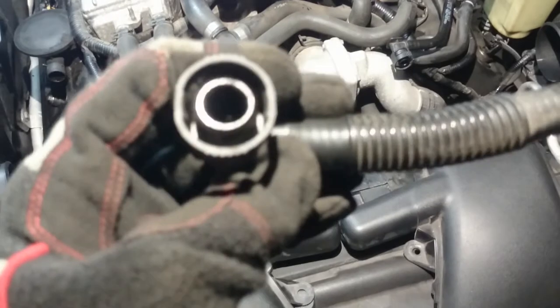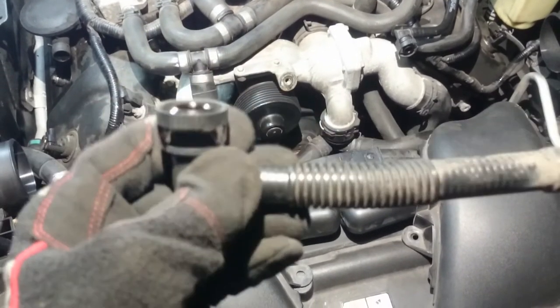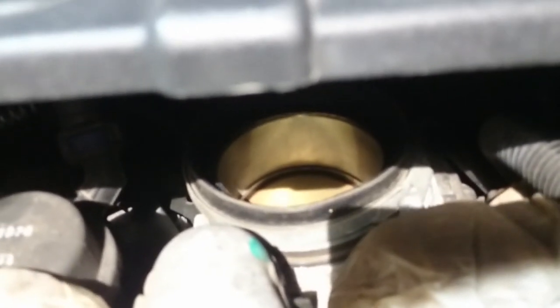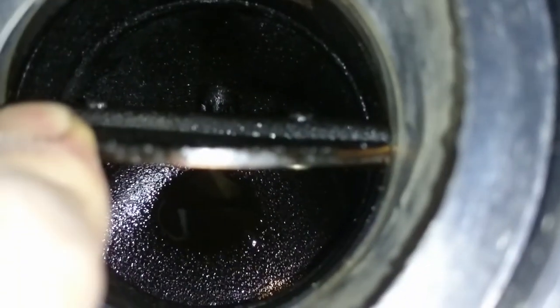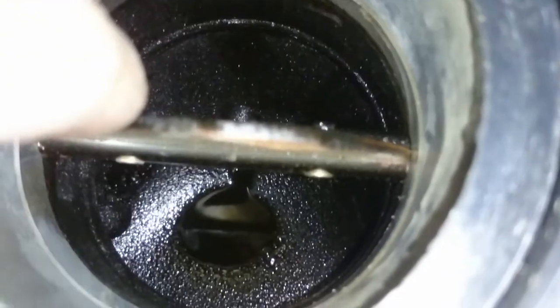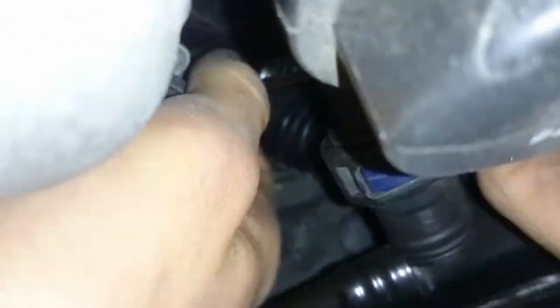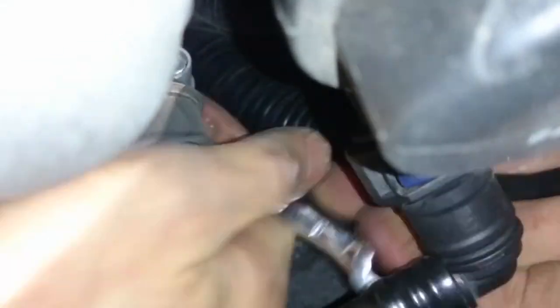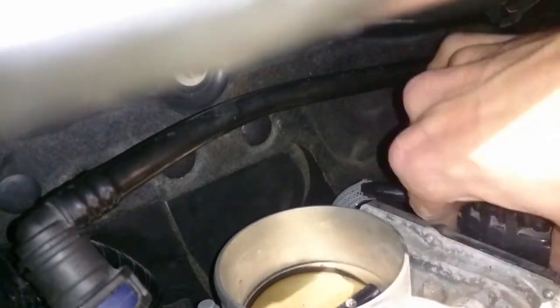I also broke an EGR bolt — a very plastic pipe that was ready to break at any moment. I went ahead and was able to pull off the top intake for the supercharger and to the back of the throttle body, as you can see right there. The top looks shiny, but there's more than meets the eye here. Check that out — that's all oil deposits, junk, gunk, and carbon. Super gooey and just nasty — this is ridiculous. So I went ahead and started diving into actually taking the throttle body completely off, getting it movable and loose. This took a long time because I could not see back there at all, just using a small 10-millimeter wrench, then I started using my ratchet set to take off the plug on the right there.